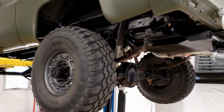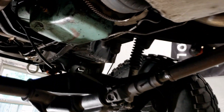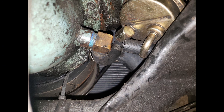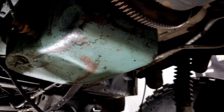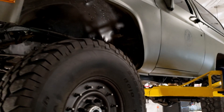We're up in the air. Even though this lift is strong and I'm confident about where I put the pucks, it's always a little weird to have this big thing hanging over your head. So this is what we're dealing with: a dented oil pan all jacked up, it's leaking up front, the turbo drain line is leaking and looks about ready to pop, a heater hose leaking, and the transmission lines are kind of ghetto. Otherwise this is a super clean truck with no rot or rust anywhere. We've got a new transmission pan and a new set of gaskets, so it's time to get started.